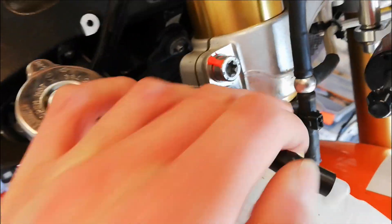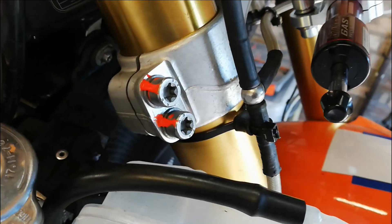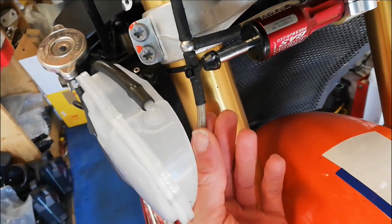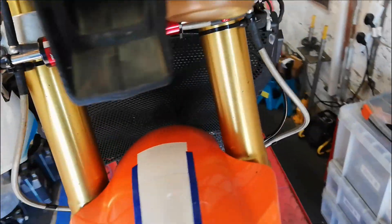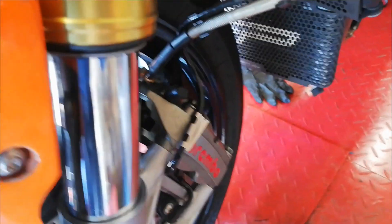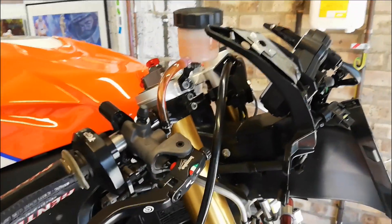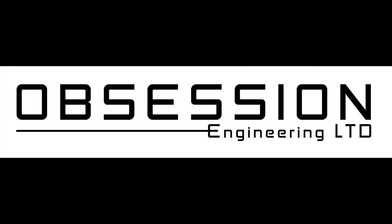A couple of little finishing touches — I use a little bit of fuel pipe cable tied here to hold the brake line exactly where I want it so it doesn't foul anything, and I'll do that on both sides and tie it in the middle. Obviously I've got the traction control cable cable tied to it as well. And that's it — a set of brakes that are as good as new. Thanks for watching and hopefully we will continue to bring you some interesting motorbike videos.